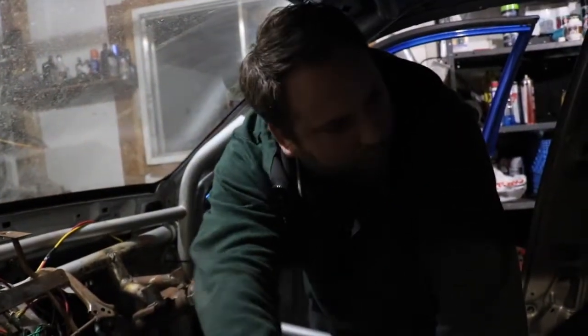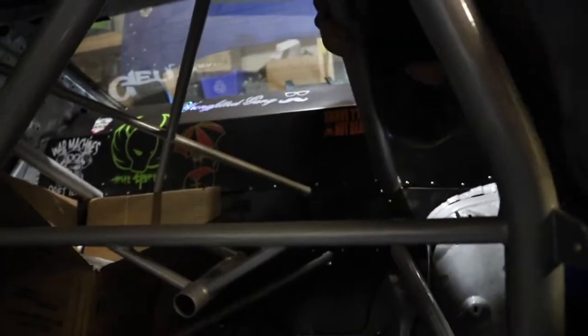Does that twisted red wire go all the way to the other fuel pump? No. It doesn't continue? It stops right here, actually, right in the relay. You got wires from the relay. So basically, we're trying to get the Lexus started, but we think that we have a fuel pump issue on the main tank feeding to the swirl pot and then going to the front. Once we figure that out, then we'll see what happens.